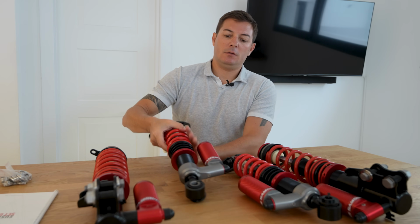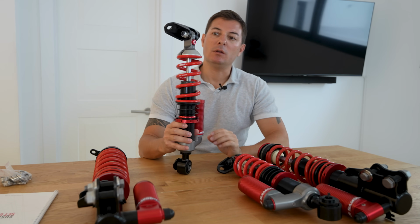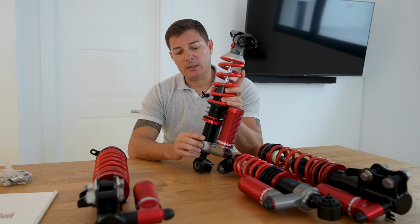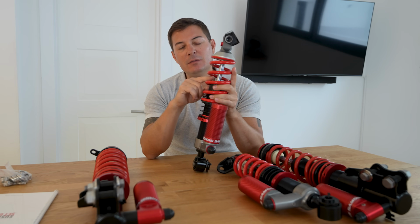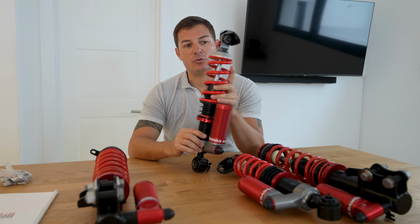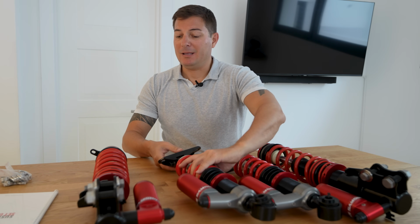The rear damper, same way. It's a coilover damper, as you see. Very, very solid mount in the back. It's all mounting solidly. And spring perches, once again, allow you a huge amount of height adjustment. And talking of this, we have 85 millimeters of free damper travel before the bump stop. And in total, it's, I would say, 105, according to what I have measured here. In the front, we have about 100 plus the bump stop, so it's 120 millimeters.